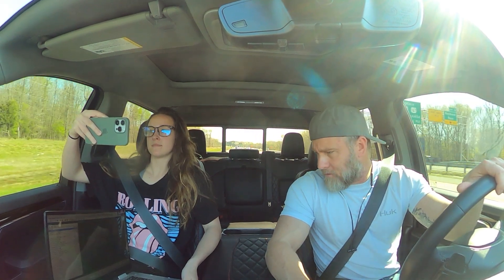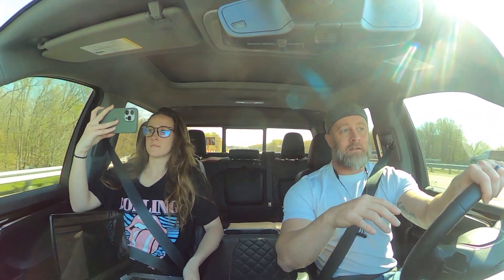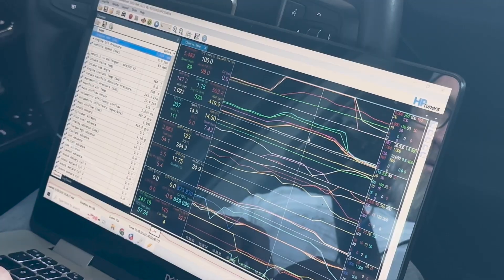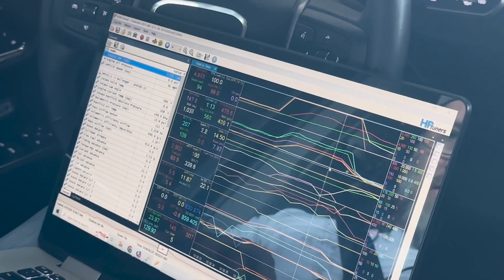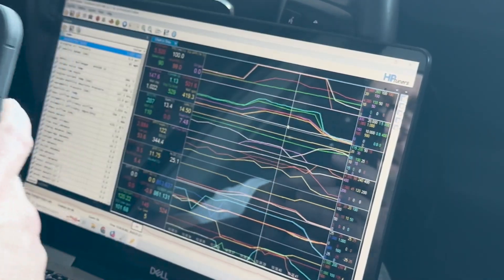A little test run. The fuel systems are so, so skinny on these trucks — there's just not much there. The power level of this truck, that's how much fuel system this truck has. You already have to run them kind of lean with the stock fuel system at like seven pounds of boost. So the question is how much fuel system do you have for this setup — and that's about it, that's all she wrote. But my error looks more consistent across the board now and not as much error, though I'm going to have to make some more changes.